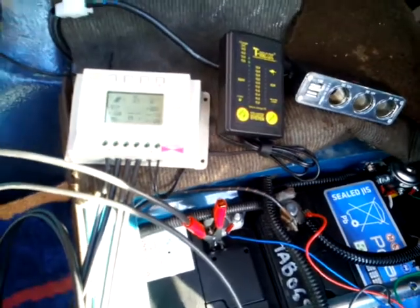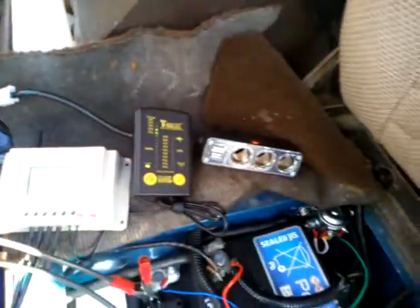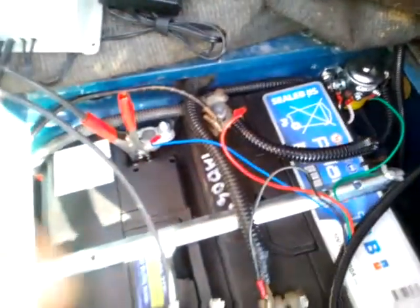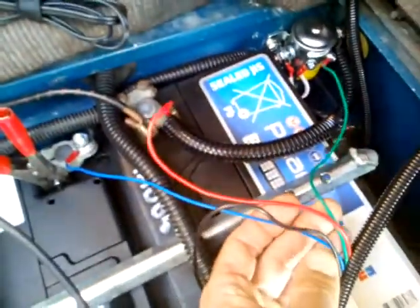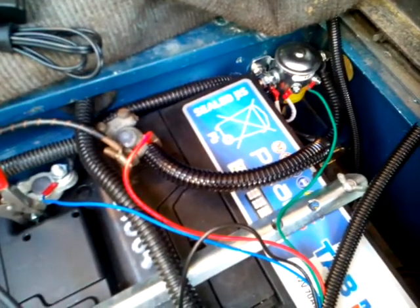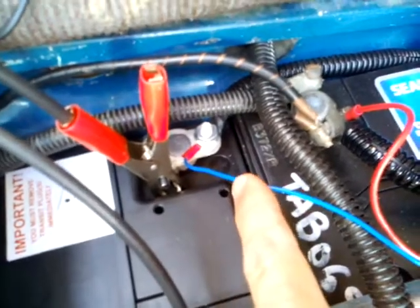So what are the pitfalls of having this linked up to a solar system? I've done it as per the T-Max instructions — the instructions aren't that brilliant, but it's a fairly simple system. All the negatives are linked up, and there are four small wires on the T-Max control unit. There's a green wire that goes to the solenoid to energize it, a red to the main battery, a blue to the auxiliary battery — both on the positive terminals — and a black earth that loops to the negative on the leisure battery.